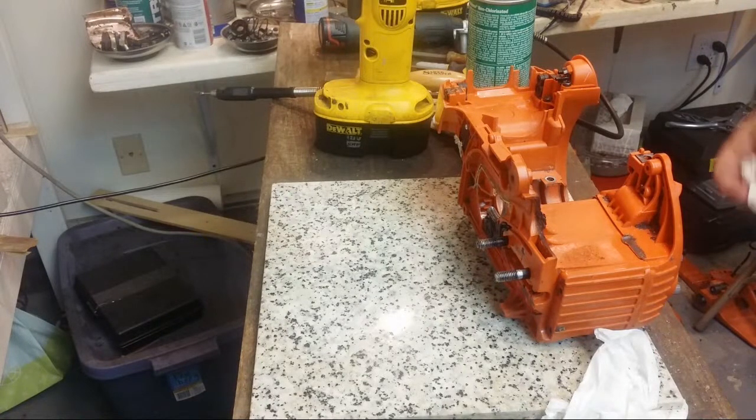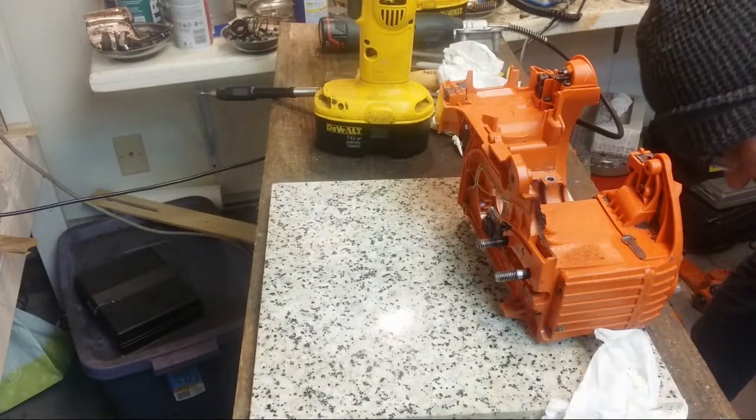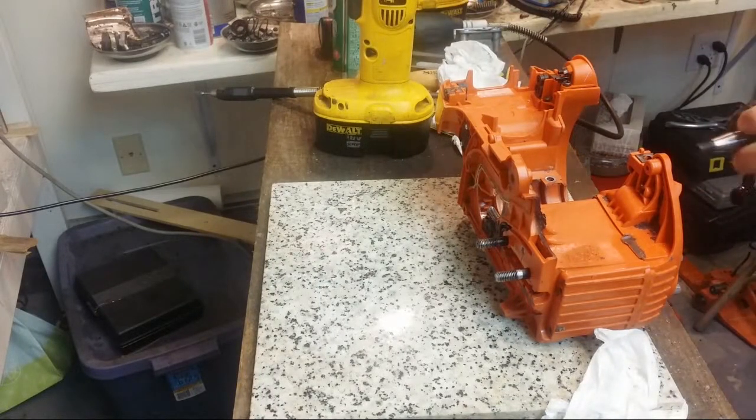these aren't super clean, but it doesn't really matter. I'm just gonna really degrease the crank. I tend to think that these seals are really a pressure fit up against the riser block and the case, so you don't need to worry as much about sealer around them.